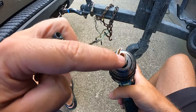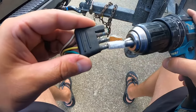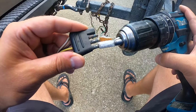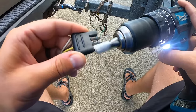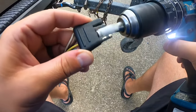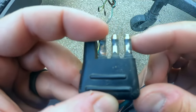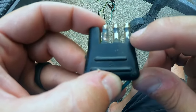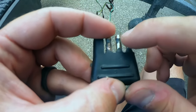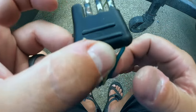The key is that the roll with the grit on the inside has to be able to fit around the connector — when it does, go ahead and sand it. As you can see, these look a whole lot nicer now and all the corrosion is off the outsides. This will make great contact with the female end of your adapter. Go ahead and plug those in, and if that worked, hit that like button to get this video out to more people. Thanks for watching!